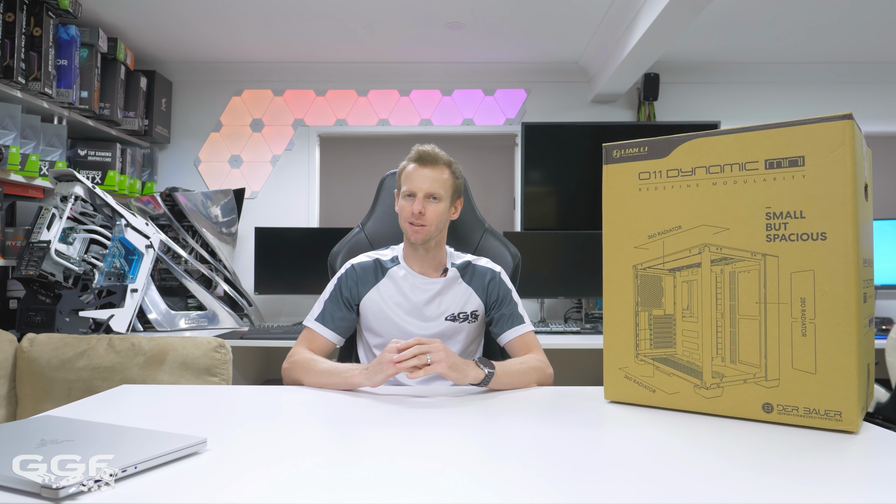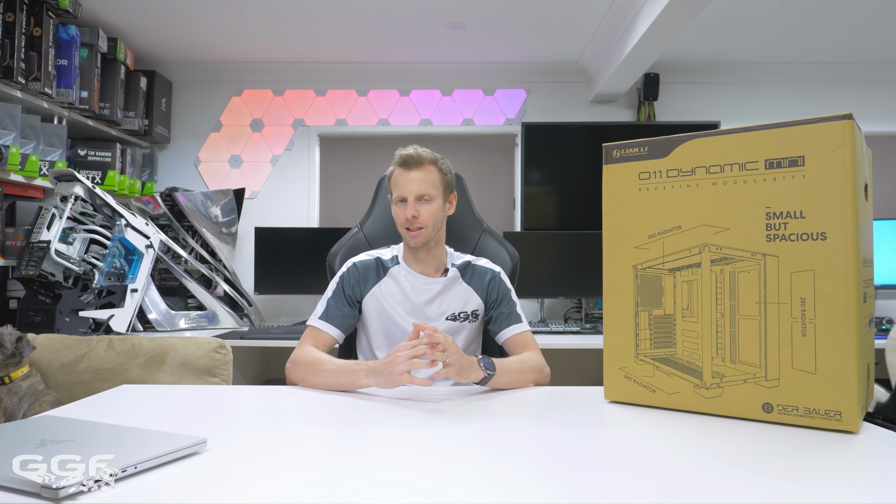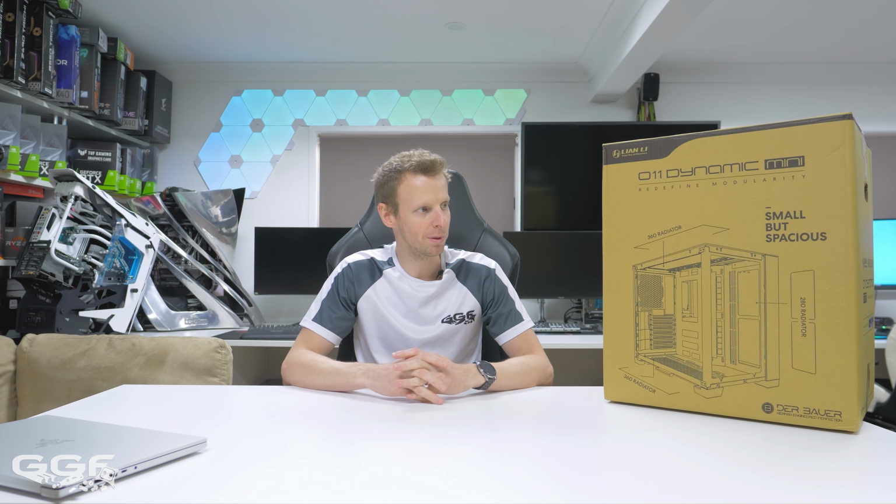But at the bottom of the motherboard, especially for an ATX motherboard, Lian Li has stated in some cases that you only have about 20 millimeters of space. But I have confirmed that you can fit thick radiators that go up past the motherboard, and we have seen this in cases like the original O11 and the O11 XL, where you can fit quite large 60 millimeter thick radiators, providing you're only using one GPU and no other slots. You can actually run them up past the motherboard. So I just wanted to point that out. But anyway, let's jump in. I won't keep you waiting any longer, so let's check it out.